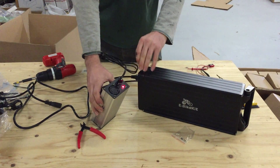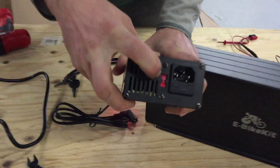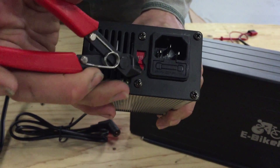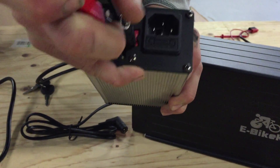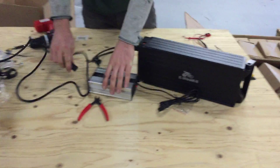The next thing to check on the charger is the voltage selection. You can see we have a selectable switch here for European and American voltage. It's on 115 right now. You can slide it back and forth — there's 230. You want it to be all the way on 115. So now we know the charger is doing pretty well.